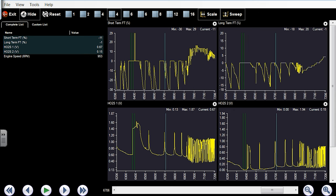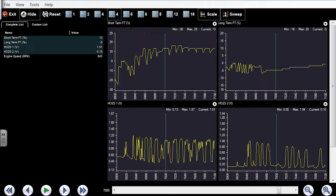Correct. Yeah. Oh, and then over here is where I revved the engine to wake that O2 up, right? And then everything was fine after that. It was always like a kind of diesel idle type deal. I don't think like under load. Here's what I think, though. I think that that misfire has contaminated that O2.